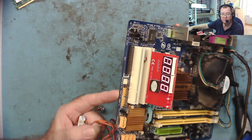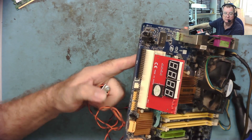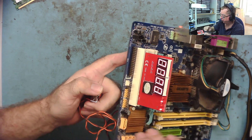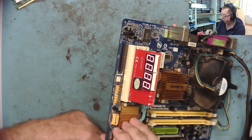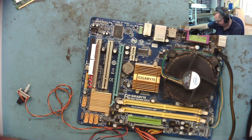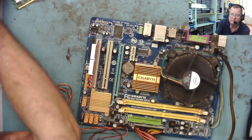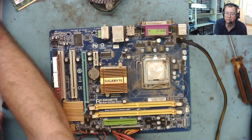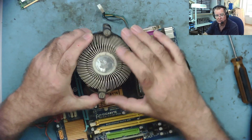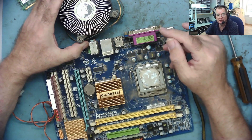Some lights lit up. We can put it in the other slot as well to be sure. Power on again - it starts on its own without having to press the switch. All zeros. So there's obviously something wrong. Let's have a look at the CPU and see if there's any thermal compound on this. Well, there is - it's sticky but it's not a lot. Also, this didn't seem to be fitted properly to me on the CPU. I'll clean all the dust up and we can try another processor in this.